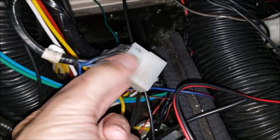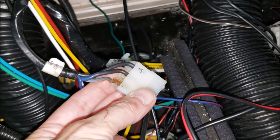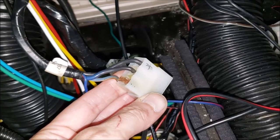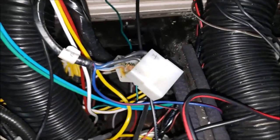The biggest thing is the ground wire — this feeds the blower motor, and that pulls a lot of amperage. I used my amp gauge a while ago and it was pulling 15 amps. It's fused at 30, running about 15 amps. So let's make a few changes and follow along.